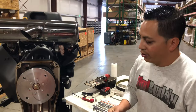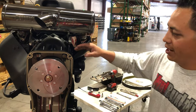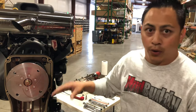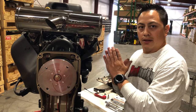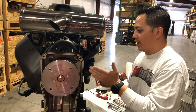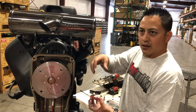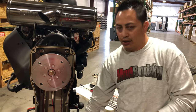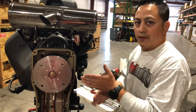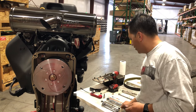Okay, here we go. I got it at 17. I'm going to leave it right there, and I'll tell you why. I'm going to leave it at 17 because by the time I tighten all the bolts — the eight bolts in here — this plate is just going to align everything. It's going to pull it back a little bit, and the belt tension will get everything together. Once I tighten the bolts on the base plate and on the bottom brackets, it's going to align everything and that's where you'll notice the other one-pound difference.